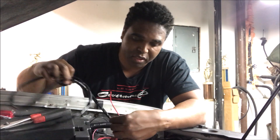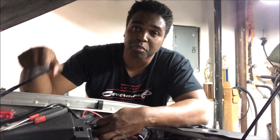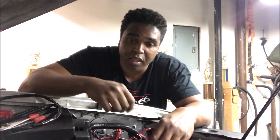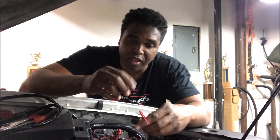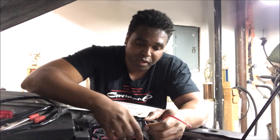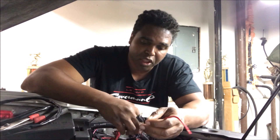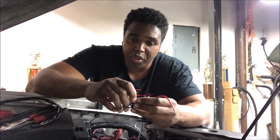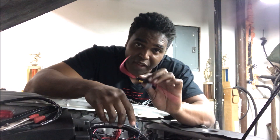This is the power harness — the harness that's going to supply power to the gauge. You're going to hook it up to a key-on circuit so when you turn the key on the gauge will come on. This thing has enough leads where you can hook up a data logger or a serial output. This gauge is pretty choice, but don't forget — always run a five amp fuse.